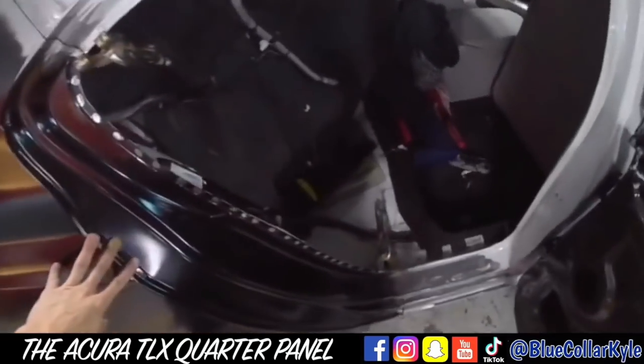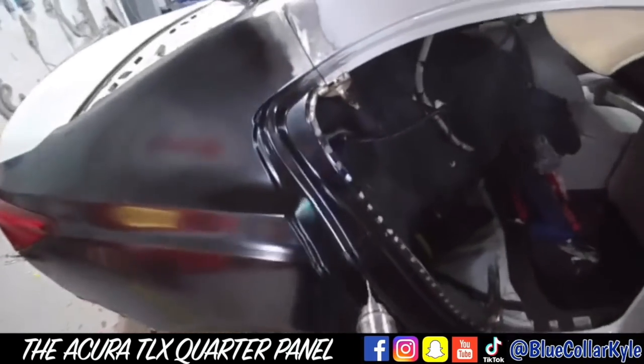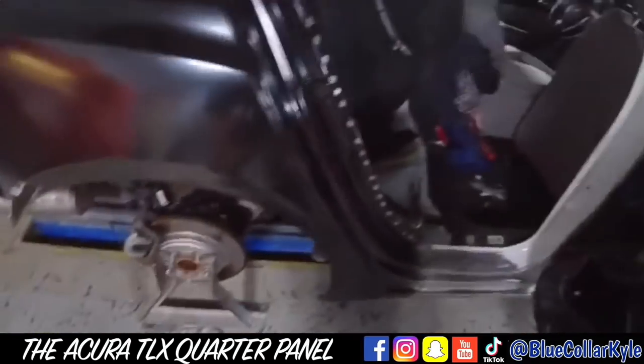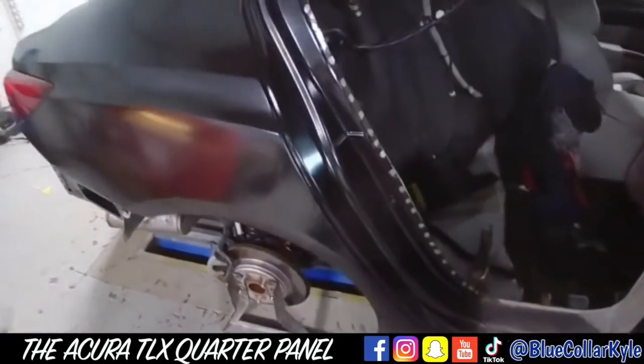Before I lift it back off though, to make sure that I put it back exactly where it's sitting right now, I'm gonna drill about 4 1/8" holes for sheet metal screws in a few different spots. And then whenever I put it back on, I'll put sheet metal screws in those holes, and that'll tell me that it's sitting exactly where I have it right now.